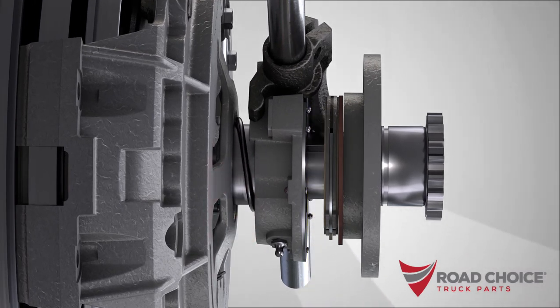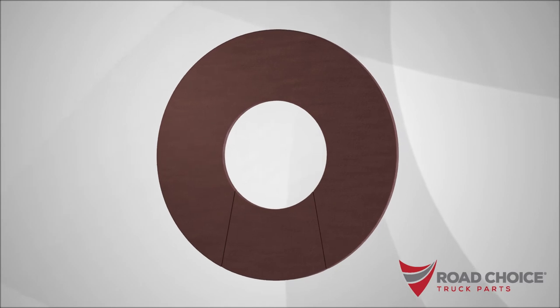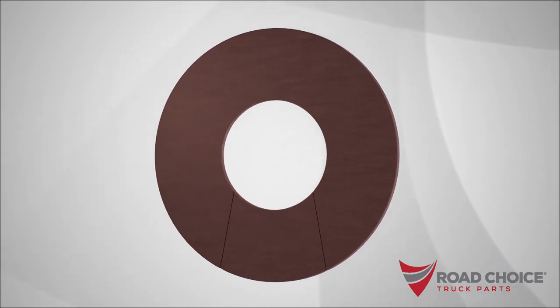So when performing an installation, don't adjust your clutch. Instead, use the fiber spacer that's included. It'll keep your clutch in its optimal operating position with the drivability you need.